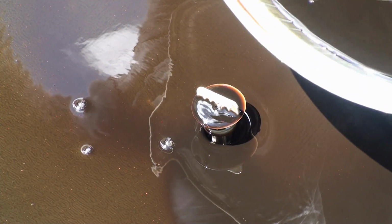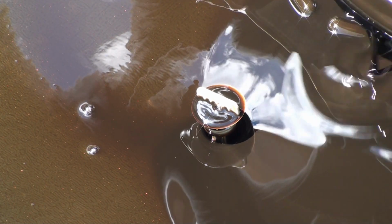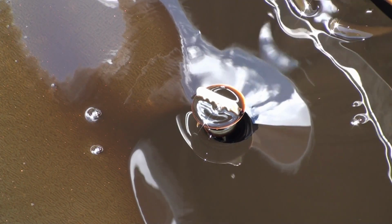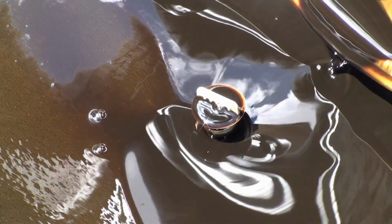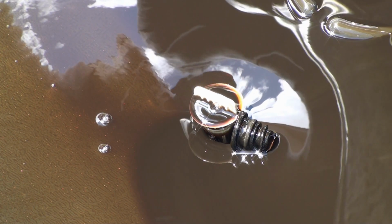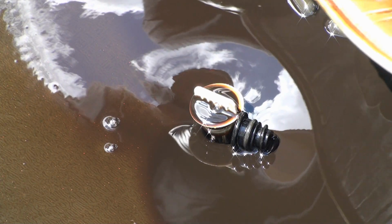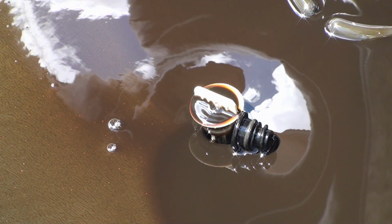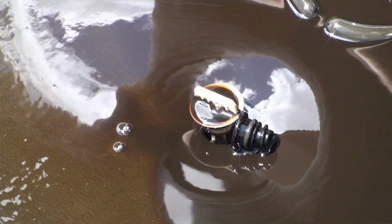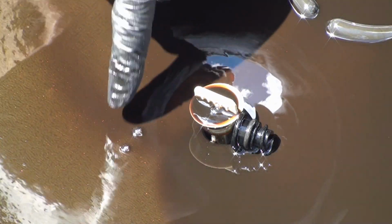Okay, let's keep pouring. I wonder if you guys can see that swirly, very, very fine metal particles in there. Okay, there's the old plug. Wow, I'm impressed. This actually is, I would say, less metal than what I had on my GTI. Wow, I mean, I'm not seeing any real pooling of particles, but in the sunlight over here, I can see little specks